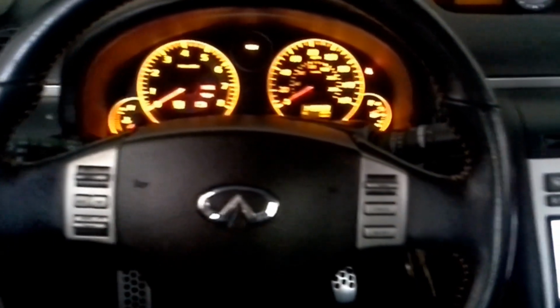Alright, it's time to go ahead and use UpRev or Cipher. The UpRev cord you can get right here that you can plug into your OBD2, and this is how you can clear codes. You can do Cipher logs. This cable allows you to see basically a whole bunch of different parameters of your engine. Actually 20 parameters at a time, but a lot. But that's a little bit too much info for this coil pack review. So let me power on my laptop.